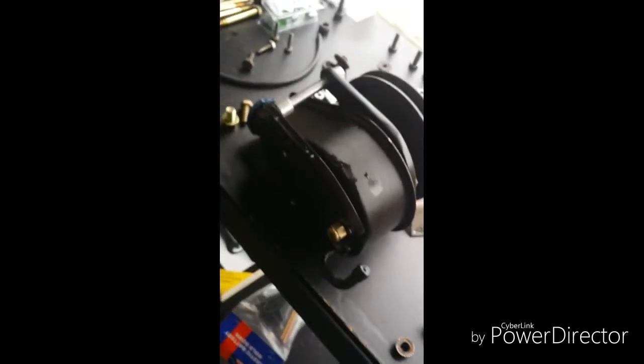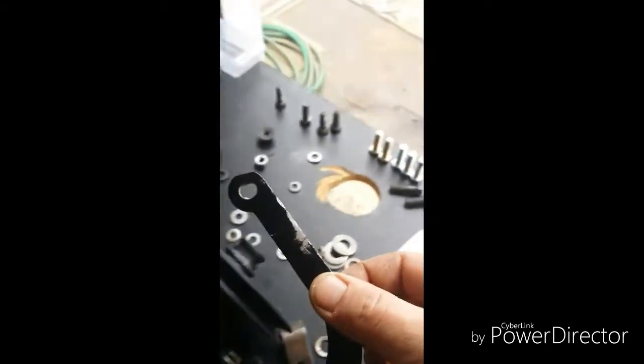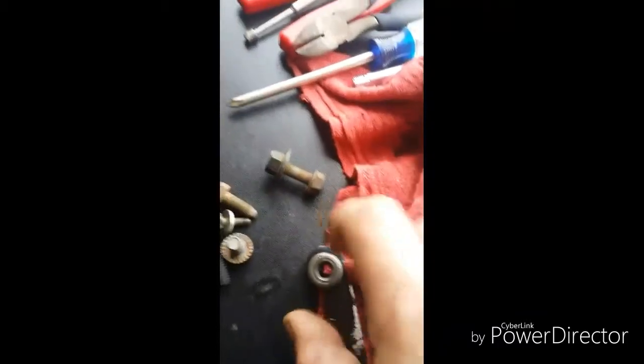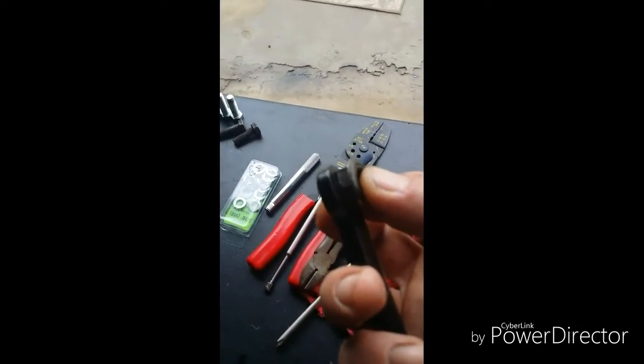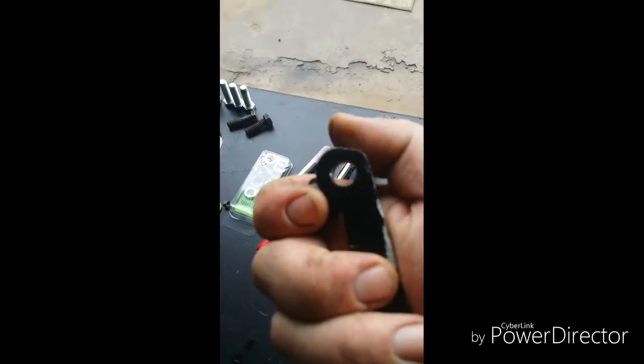This is probably a universal kit, so I just didn't realize it'd be this much involved. What I'm going to do, instead of trying to grind on the block to make room for the nut, is drill this hole out a little larger to slide a nut in it. I'm going to put this nut right inside the bracket head there and then weld it, so the nut will be inside the bracket and the bolt will thread right into the bracket itself. It'll become one piece - you won't have to worry about trying to use your big fat fingers to hold a nut in place. That flat spot they put on it tries to make room, but it's just not enough.